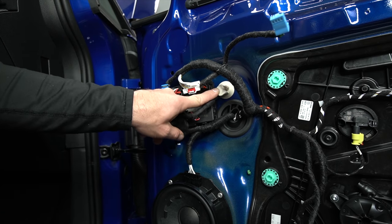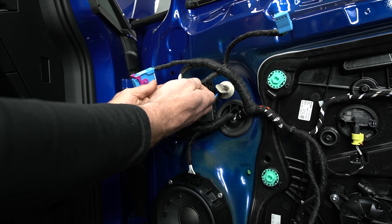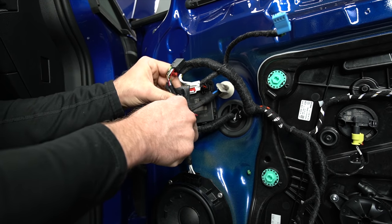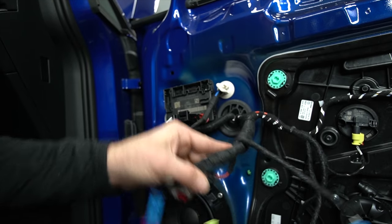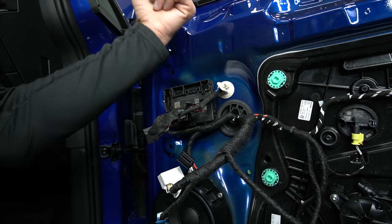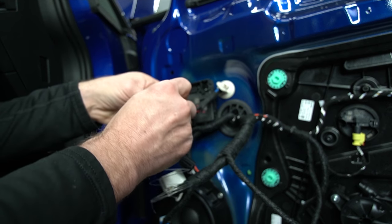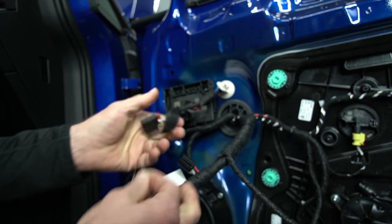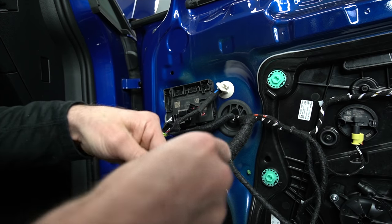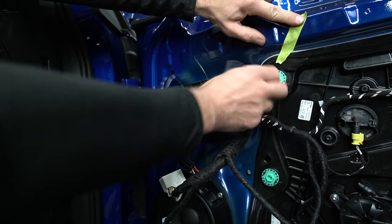Here's our passenger side door module. The ones for our mirror are this pass-through right here. I want to get these connectors out of the way so we can see a little bit better. This one we have to disconnect because it's for our mirror, and this one down here is the other one. Luckily these only go in one way, so you don't have to worry about them getting connected in a different place. Now, before we do anything else — this is our wire we're gonna be running out the door and then back in. Grab some fishing line, tie it around either one of the connectors so you can pull it out and back in without having to mess around with fishing wires. I like to put a little tape on there so our guide doesn't come off, then tape the other end of the fishing line to the door so it doesn't accidentally come with us.